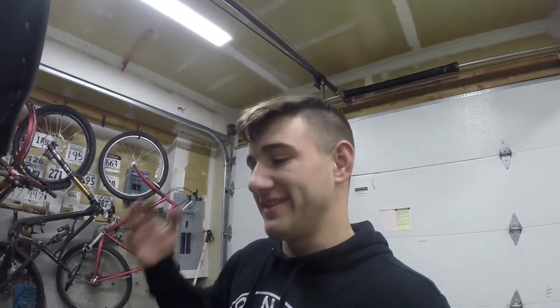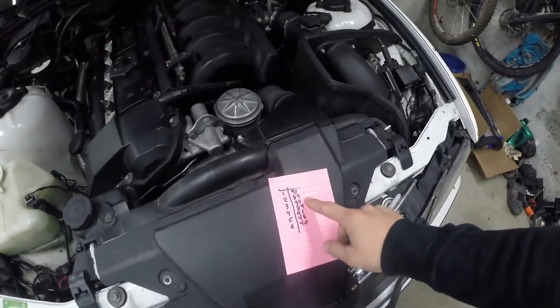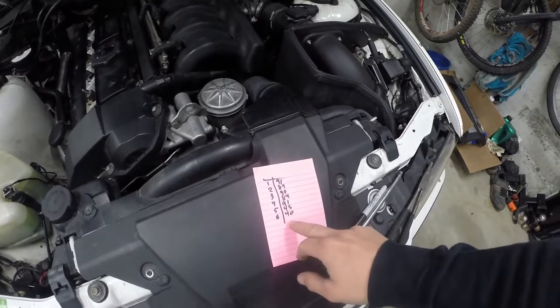I figured out I had to be outside the car to watch the gauge because it doesn't stay up there — your valves could be open and the pressure goes out. I did the test with my dad and he helped me. Something's bad. We got 91, 89, 90, 89, 91, then 45 and 40. I think the reason the rest of them are so low is just because my rings are gapped really wide and I have low compression pistons for high boost or a big nitrous setup.